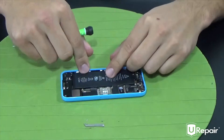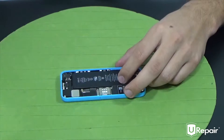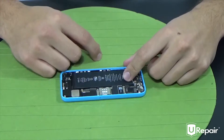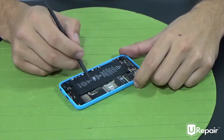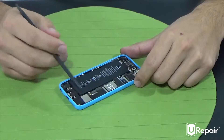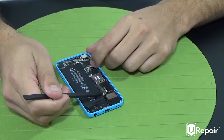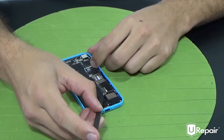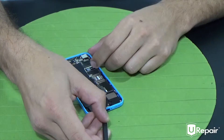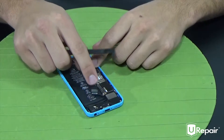Placing them inside of your box in the same manner. You always want to remind yourself exactly where the screws belong, because if you were to mix up any of the screws, you risk highly damaging your device. Now we are going to disconnect the bottom cable — this is the cable for your battery. We will be using the tip of our spudger and insert it in the little gap in between the standoff screw and the connector itself, and pry the cable up gently. Once you see the cable come loose, fold it inward towards the inside of the battery.